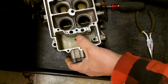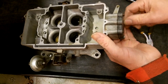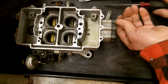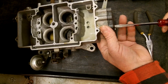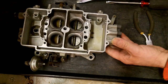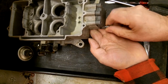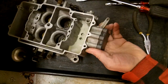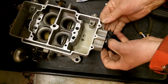You've got a plastic lever — we do have these available. I may be the only one left that has them because they told me they were discontinuing them. You may have the one with the metal lever. Somebody put a different screw in this — that's a red flag to me. Either they lost the screw, which is okay because I'm going to put new ones in it, or they stripped it and put another screw in. This is your secondary, and the secondary has a spring on it. The secondary diaphragm does not come in any of the kits unless you buy the hardware kit — it's included there.